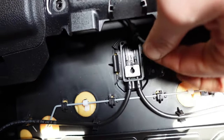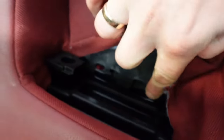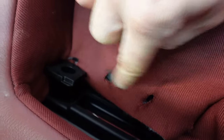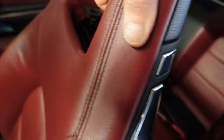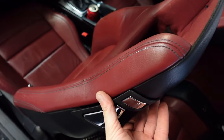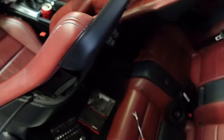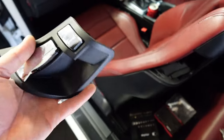All you need to do is just pull it out and wiggle it out that hole. That's the wire now loose. There are four wee hooks — one, two, three, and a fourth one right there — that hold the actual trim in place. And there are two bolts that hold the actual handle in place. We're going to remove those two Torx screws. Now that the two screws are removed, it just pulls out — held on by a wee clip — so a wee wiggle and that's the handle out.